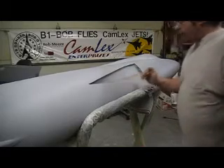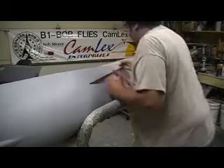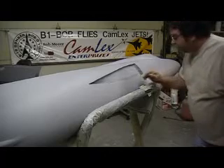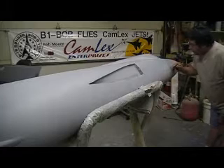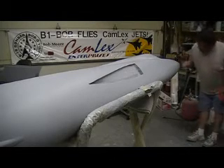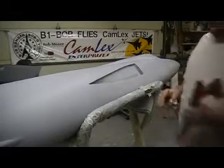This little area here I dug out — it just didn't look good. Here's the old wheel driver and my big block sander. This time we want to be careful; I don't want to sand all the way back down to the glass. Then I'll have more pinhole issues. Every time you get down to the glass and start sanding into it, we don't want to do that anymore if we can avoid it.